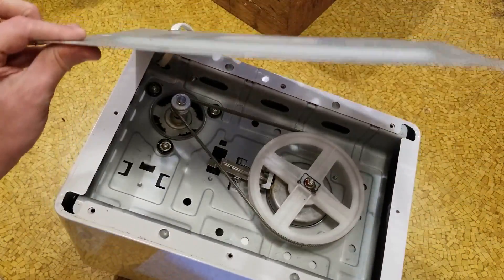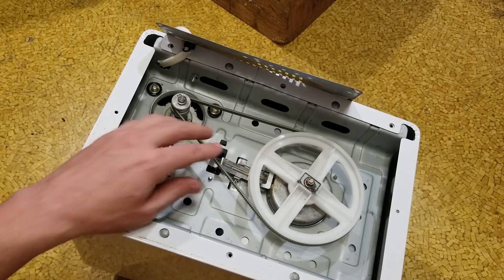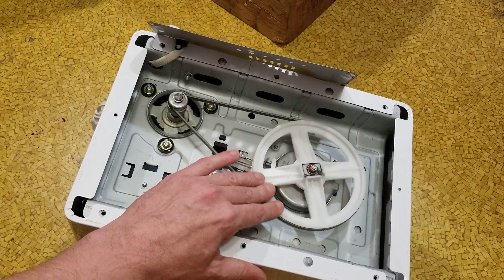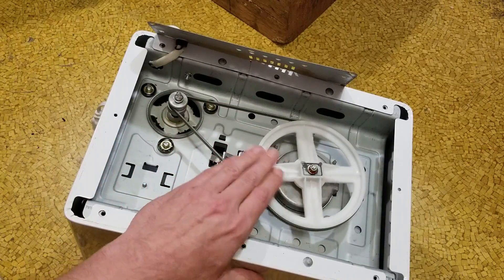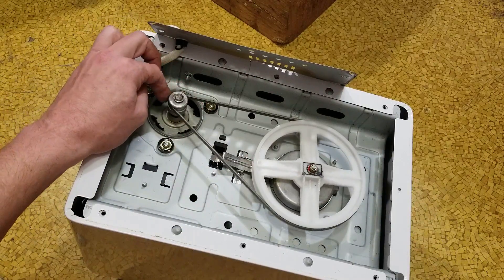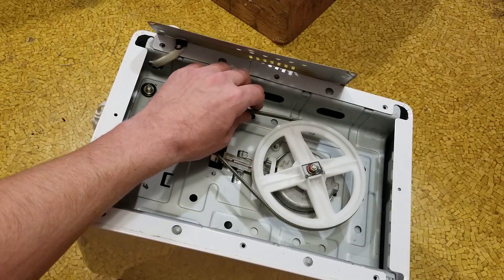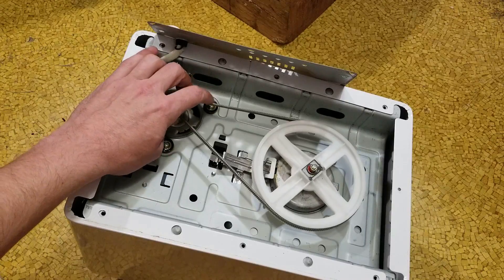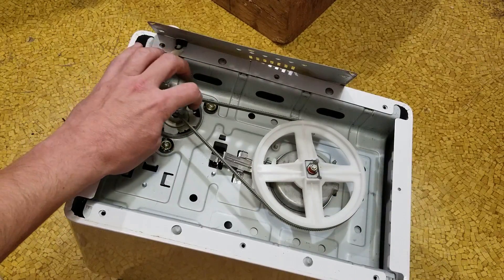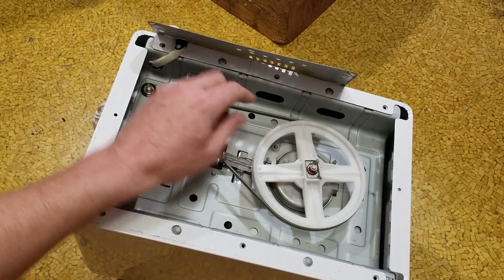There's our power cord going up through there, and this is indeed a belt drive — a lot of them are apparently like this. There's a plastic nylon pulley. The hot spindle — even though the spindle on the motor is aluminum, I kind of like that. It's a corrugated toothed belt; the teeth add more friction and more surface area, just like multi-toothed serpentine belts on automobiles. They have the undercuts on the motor pulley but not on the plastic one, so obviously this motor is being used in a variety of different products.